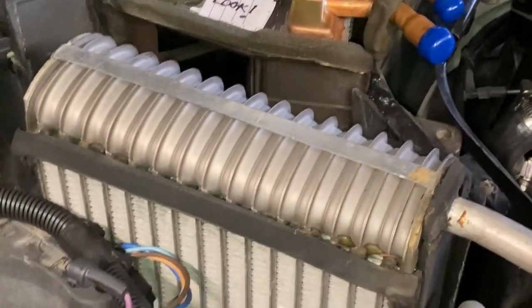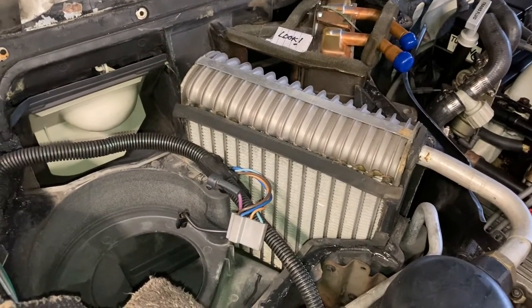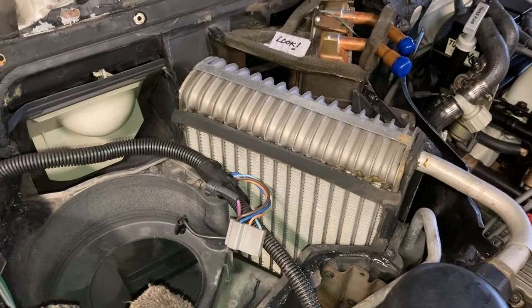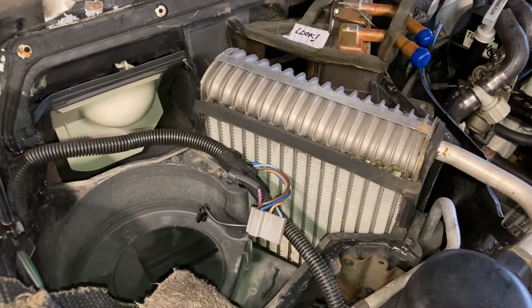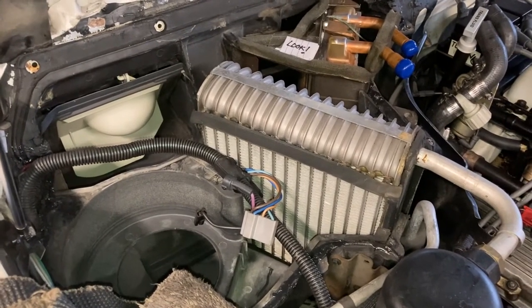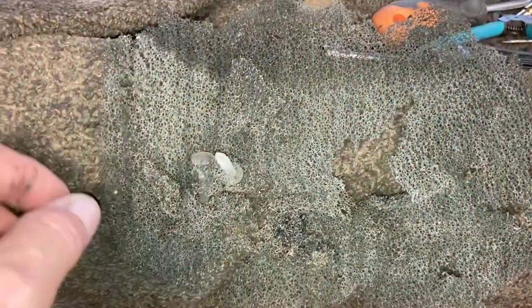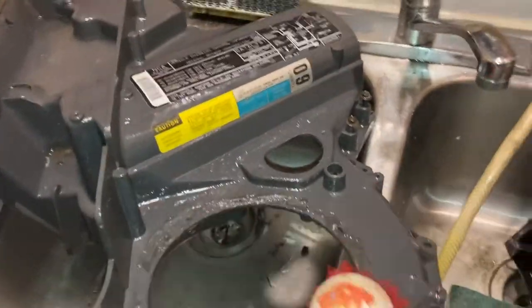It's called an immersion evaporator screen that abates mold, because, you know, asbestos is out, mold's in, right? And kills fungi and mold spores. And that's what this was, tacked with these little pins here. See, that's what's left of that pad. And you just push these pegs in. Let's scrub this, clean it up.